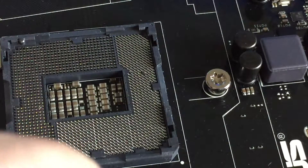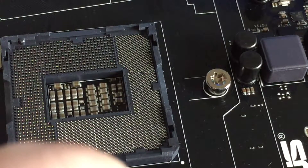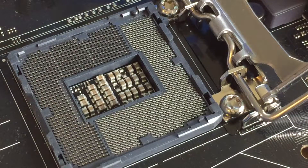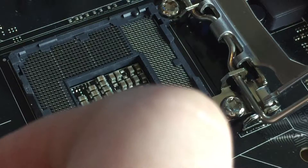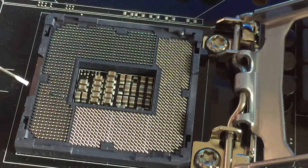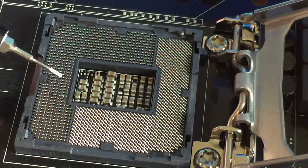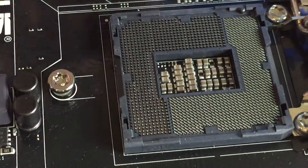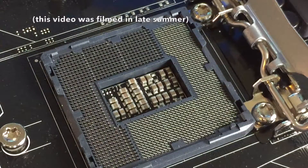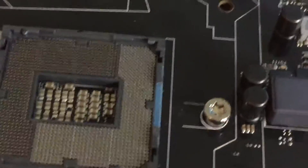Nothing like this one — this one is actually completely folded over the wrong way. So I'm just bending that over a bit to get it centered and aligned. I'll do the same with this one. So the most damaged area of the socket is right here; we have a couple of pins that are completely folded over — one up here and one down there. It looks like these two pins are actually kind of tangled together, and this one is just bent over. I managed to fix that one pretty easily, though you can still see it sticking out a little bit. Sorry for the background noise — someone is mowing our lawn right now. That pin took me about 25 minutes.